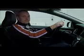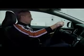Dan, one last thing. Now you can use the preconditioning functions to set the car up the way you like it. Yep. First you choose outdoor or indoor parking. The outdoor option uses a fuel-operated heater, while the indoor option uses electricity. Then, of course, the time for when you want your car preconditioned. As it's a bit chilly here in Sweden at the moment, the car will in this case be heated at 7 AM tomorrow. If we had been somewhere nice and hot, the car would have been cooled instead.